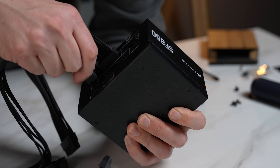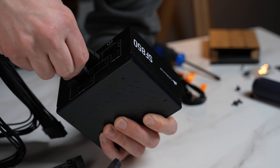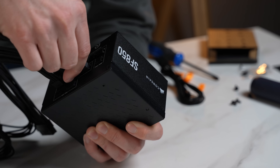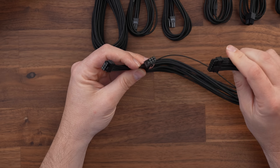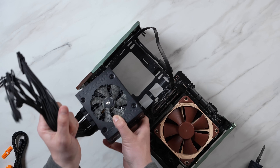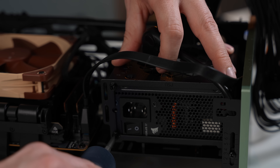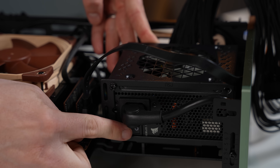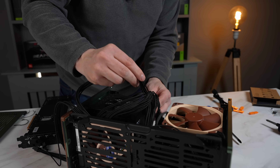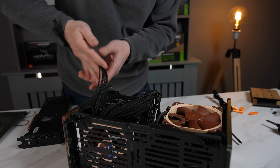Before I screw this PSU into the actual bracket, I'm going to connect my cables. As always with small form factor builds, just install the cables that you actually need. In my case, I'm going to be using the 24-pin and 8-pin motherboard cables, and I'm also going to be using an AMD GPU, so I'm installing my PCIe cables instead of the flaming hot 12VHPWR cables. Next, install the PSU bracket to that PSU and screw that bracket into place. Make sure you plug your power cable into the PSU and turn on the PSU switch so you're not scratching your head later on. Plug in the motherboard cables, then pass through your two graphics card cables to the other side ready for when you install your graphics card. I also tidied up the cables, making sure that none are snagging on that base exhaust fan.